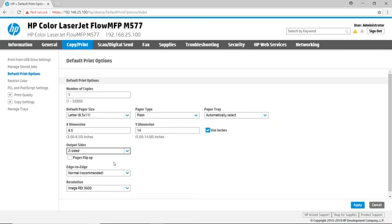The Networking tab provides the ability to control the communication functionality of the printer. The Wireless Station page, if available, allows you to connect to an existing wireless network. The TCP/IP page controls the network connection information such as domain membership, DNS settings, IPv4 and IPv6 settings, as well as controlling some of the advanced security features such as HP Connection Inspector. The Network Settings page contains configuration options for SNMP settings, including enabling or disabling SNMPv1 and v2 read-write settings and creating the SNMPv3 passphrase. The Other Settings page shows several additional communication protocols that are active and allows you to enable or disable each one to further secure your printer.